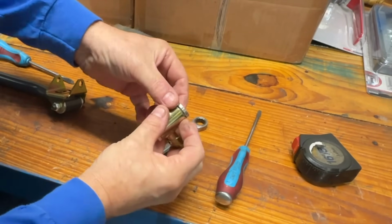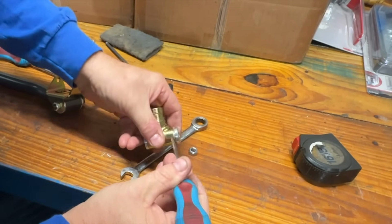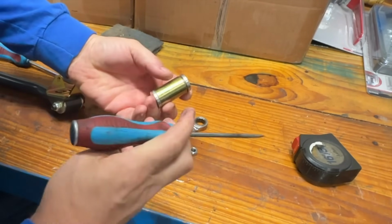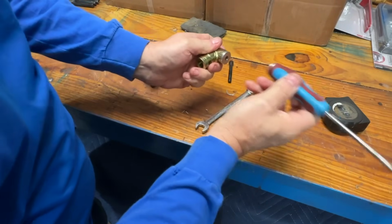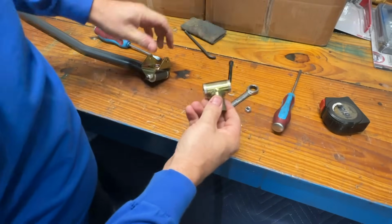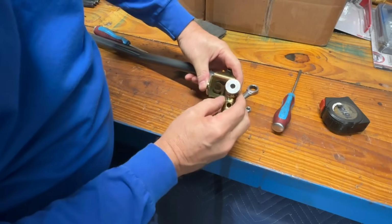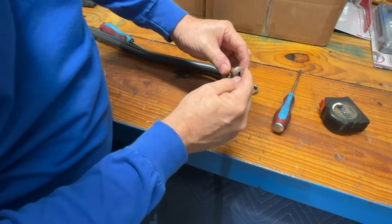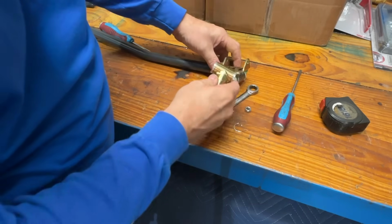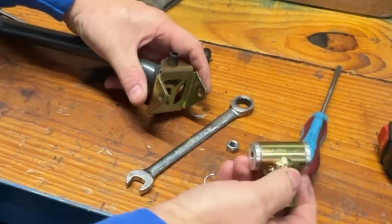So this is just aluminum where it's being pressed together. There isn't actually a bushing in here. So this isn't actually a bushing. These are just squished together, and you're tightening it, and that is your bushing, which it really should have some kind of nylon bushing on each side of here if that is going to be tight in there. This is kind of disappointing.